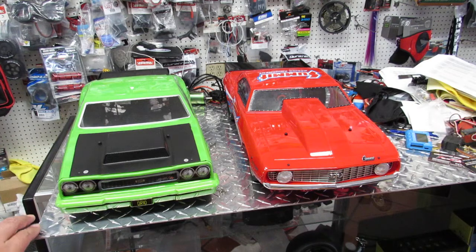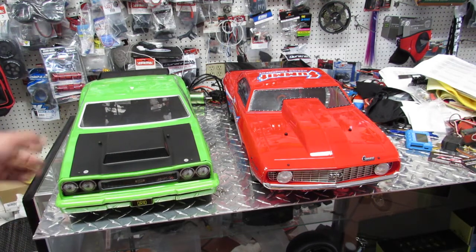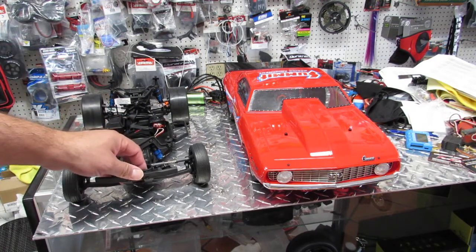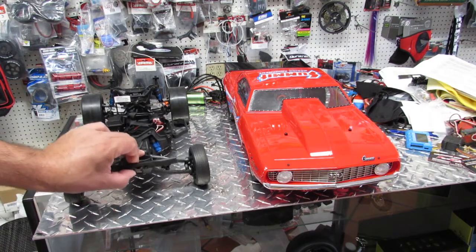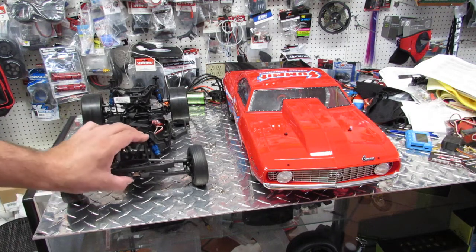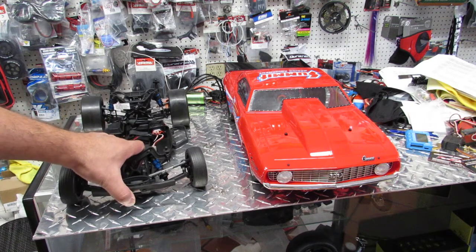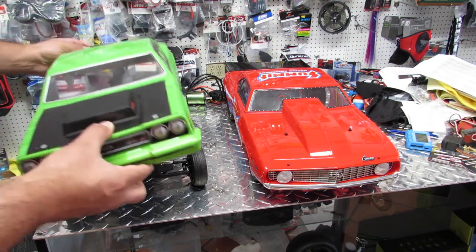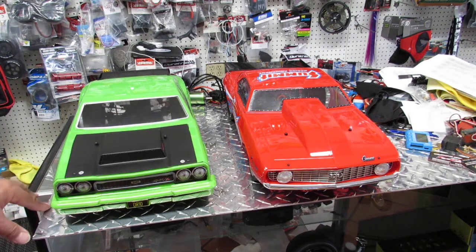On the front of the drag racing car, whenever you want to go faster, you want more traction and more control over your vehicle. So one of the secrets is to put weight over here, like tire balancing weights or fishing weights, and make the front a little bit heavier. When the car wants to pop a wheelie, you're losing a lot of traction. But when the entire car is heavier on the ground and pushing forward, it has better grip, and you get a much better result and launch much faster. This is something very important that you guys have to pay attention to.